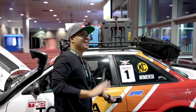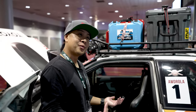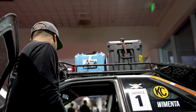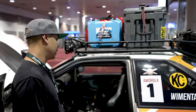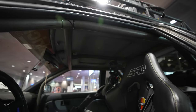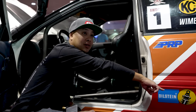The roof rack has a story itself. After I was done with the all-wheel-drive conversion, I got to do the rest of the suspension. What better person to work with if I needed a four-link — I took it to a trophy truck builder, Dempsey Fabrication. I said I need a roll cage and suspension. He looked at it and said, 'I thought you were going to bring me a truck.' And I said, no, it's a Corolla. This whole cage is per rally spec — it's DOM. They tied in the roof rack itself, and there's a subframe that goes all the way down and ties to the rear axle to make it a four-link.